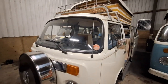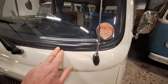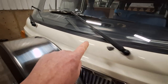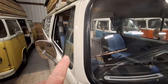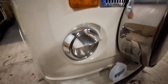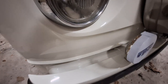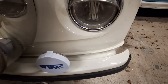What I'll try to do is take you around panel by panel to show you just how good she is. We look at common areas like the rubbers - you want to see that they're nice and supple, not dried out, because the dried-out ones will crack and hold water. Look along the bottom of the windscreen and you can see there's no issues at all. Then up on the A-post, if we look down through all the front panel, it's absolutely fine. We look along here because it's an area that water can trap, and there's no problems there at all.